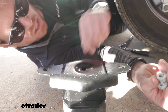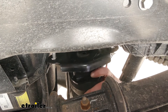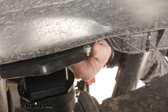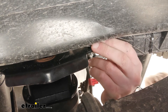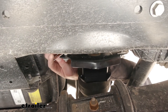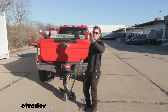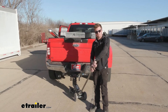I'm just going over it now because you might not be able to get a great shot, but now you can just take it and put it back exactly where the other one was. Pretty simple. Now I've got plenty of room — put on our old nuts, take our little shims and put them into place. Then we just need to grab the 15 millimeter socket and hand tighten this. Once we get that all tightened down, you can go ahead and do the same thing on the other side. We got both sides done, so now bring her down. And we're gonna take it on that same exact test course and see how they do.